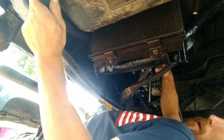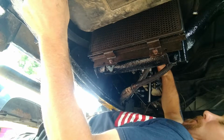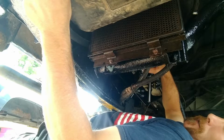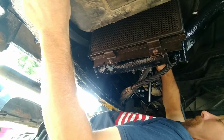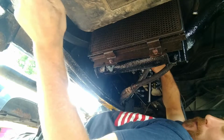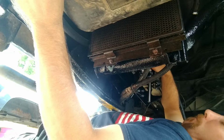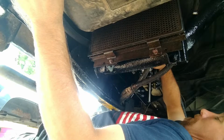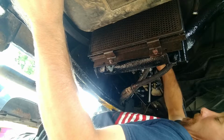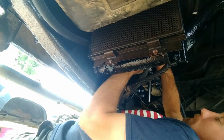All right. So now we're ready to start routing our hoses. Like I said, I have this sump installed on here, and it actually has the return fitting on it as well. So my return from the AirDog is going to go back through this sump. I've already kind of routed the hose the way I want it. I have it set up to mimic how it's going to be on that barb fitting back there, with the fitting like it's going to be coupled onto the AirDog up here, and just get the best guess that you can give it.